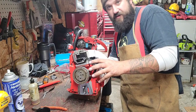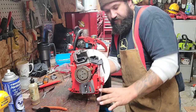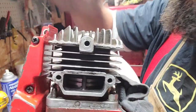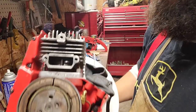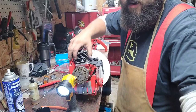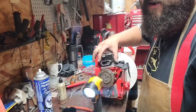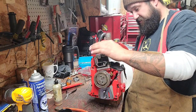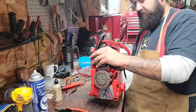Okay. My exhaust opens at 105. So I know that. So I'm going to read my wheel. I'm going to keep turning it. Now look. So let me get my flashlight. You see how the ring, this thing moved a little bit. You see how the ring, I can feel the tension there. The bottom of the ring is at the top of the exhaust port, which is 105 degrees. So all I'm doing here is I'm going to use our timing wheel to set my roof, which will be the bottom of the ring or the top of the piston. Okay, so I'm going to set it up to where I want it, right there, and I'm going to turn the wheel back. Does that make sense?